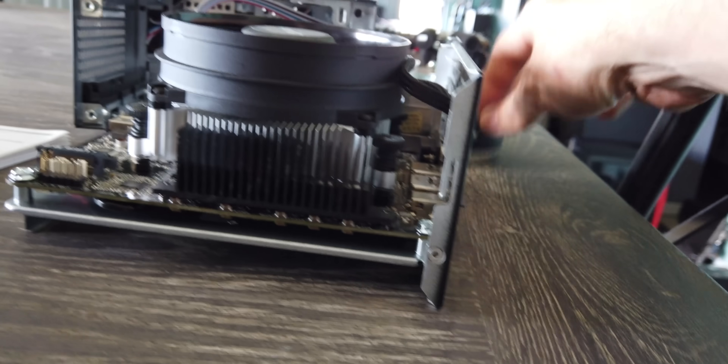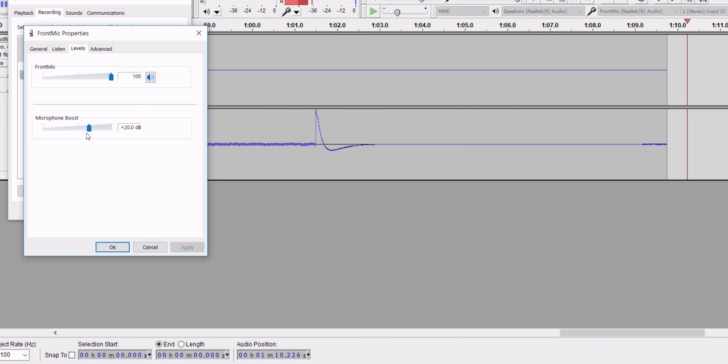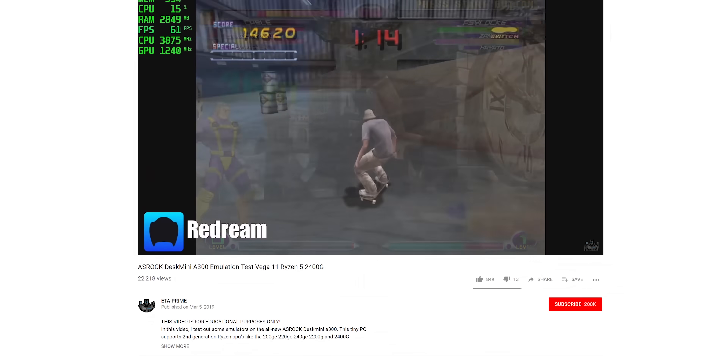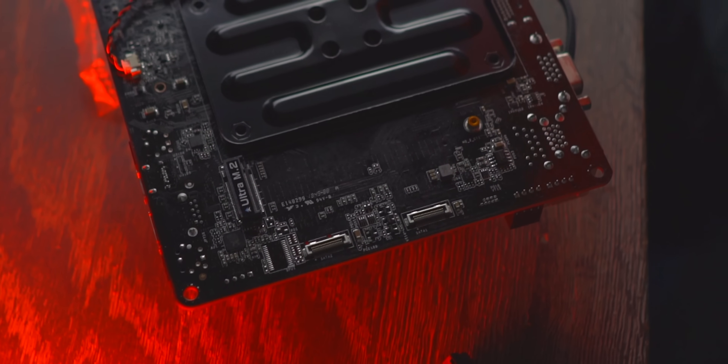You've got HDMI out for audio too, and if you're an audio purist you can use an HDMI to optical audio extractor. One important thing to note: the M.2 NVMe slots only support PCIe M.2 - you cannot use a SATA M.2, otherwise it won't boot. So keep that in mind - the two PCIe NVMe slots, one on the front and one on the back, only support PCIe NVMe. But other than that, this unit is rock solid from ASRock - or should I say ASRock Solid.